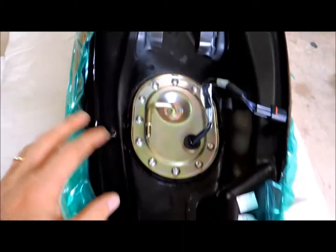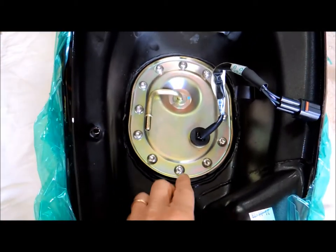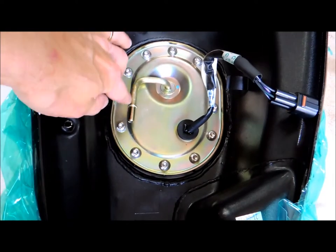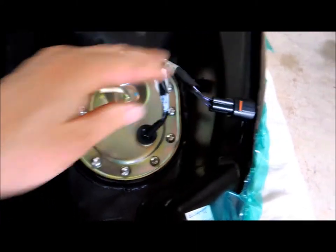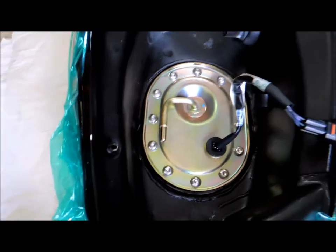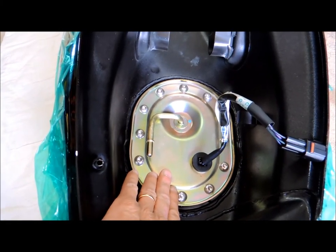When you get the tank off, this is the self-sealing fuel line, this is the electrical connector, and this is a little overflow thing. Those are the three things you need to remove, and then the tank comes right off. Here's the underside of the tank — there is actually quite a bit of fuel still left in there, but I think I'll be alright. This whole unit is what I need to take off, so there's just a lot of little bolts there.